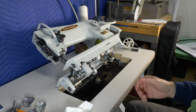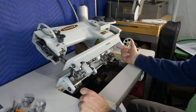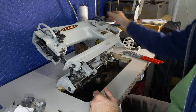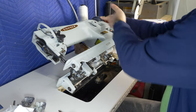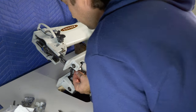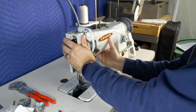This is what we call half-splitting. Whenever you're doing troubleshooting on any equipment, you want to half-split the faults - that way you eliminate 50% of the possible causes in one shot. This point is halfway between the top half and the lower half, which is why I'm going for that. We've gotten both screws loosened, and now the needle moves up and down easily, the top shaft moves easily, the down shaft moves easily - and our problem is down in the hook area.